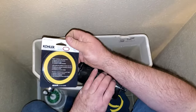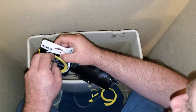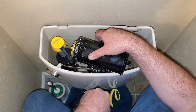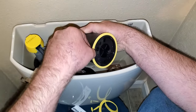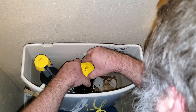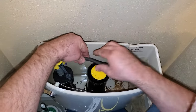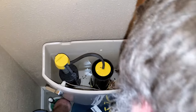We'll go ahead and get out our new one. I just picked this one up at Lowe's. They had the knockoff or aftermarket variety and the difference was like 50 cents to get the original equipment one or the aftermarket one. I went ahead and got the OEM one — you can see how flexible this guy is compared to how not flexible the old one is. Right here at the bottom, just got this ring, slip this right around here, you can see it goes right in the ring. Set this back down, get it centered, just turn this thing clockwise and it'll click right in. Then go ahead and put your line right back on here.